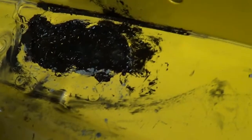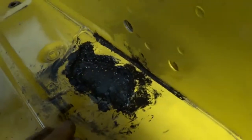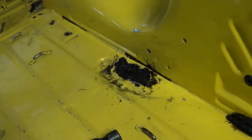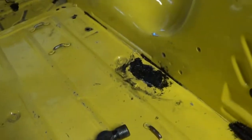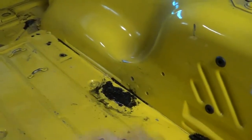This didn't go quite the way I wanted. I had cleaned it all out, went around the edges with pour patch, and it had slipped in perfectly dry. But then I coated it in pour patch and tried to put it in and it just didn't fit. I ended up getting pretty messy — took a chisel and hammer, really worked it into the sides. I took the metal that was twisted up, hammered it back down, added more pour patch, and now I'm just leaving it. It'll harden, I'll sand it tomorrow and smooth it out as best I can. With the bed liner sitting on it, I think it's going to come out pretty well.